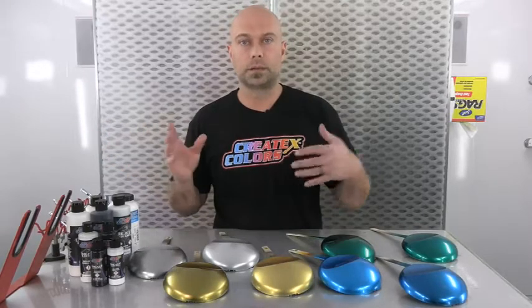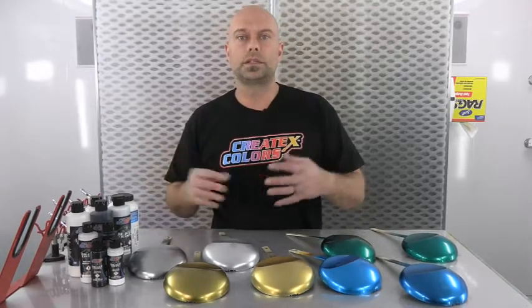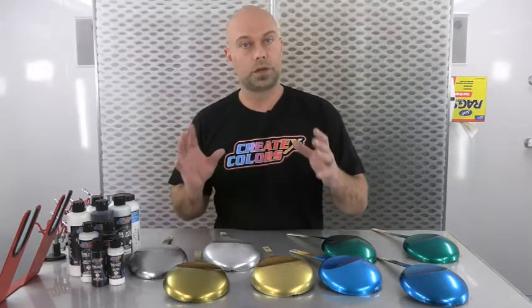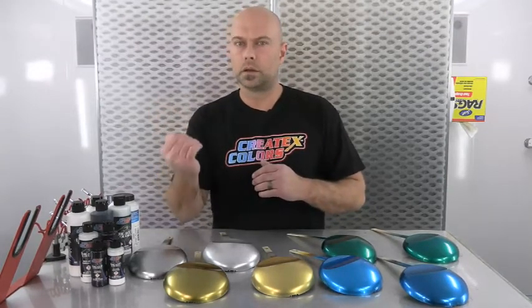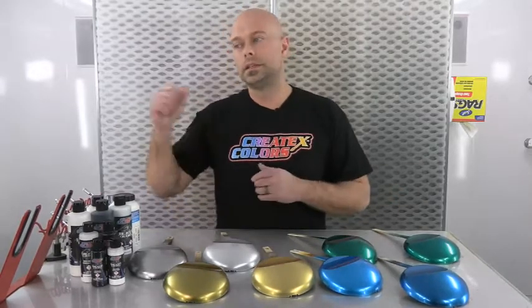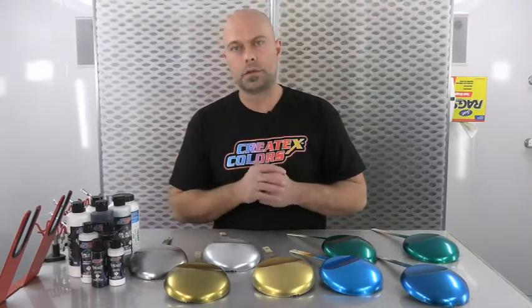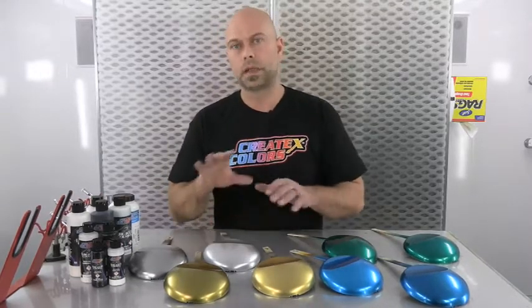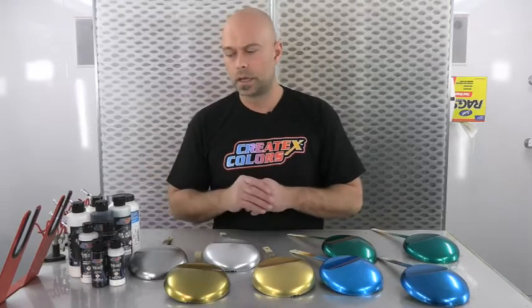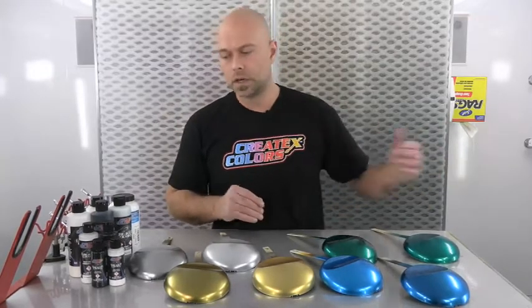This doesn't catalyze, but we've noticed the longer you let it sit once reduced, the shine will come down a little bit. So if you're going to spray within a six to eight hour time frame, mix it that day. If you put it down overnight and come back tomorrow, you might notice a loss in gloss level. What you're going to spray at that particular moment — mix that and use that. It's not that it goes bad, but there's a noticeable loss of gloss if left overnight or especially two days.